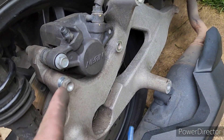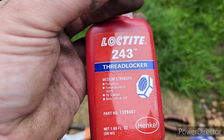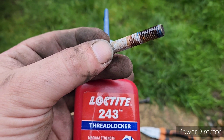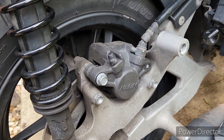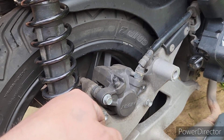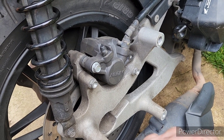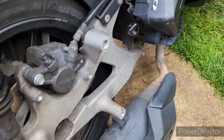When you put the bolts back in, make sure you put some thread lock on — blue will be sufficient, you don't need red as red is more difficult to undo. Just make sure you put some on so they don't come loose. Same as the front: do it hand tight and when you're tightening up that last bit, get somebody to hold the back brake for you — it aligns everything. Then just put your exhaust back on and that's it, job's done.